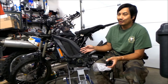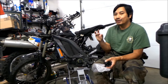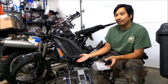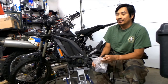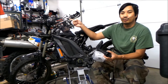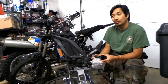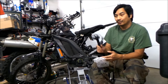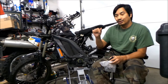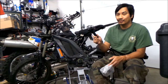I changed it with a brand new throttle box and it's felt a lot better than the one I replaced — those throttle boxes wear out after a while with all that dirt getting up in there and gunking it up. With this new one, there's less chance of that happening because all the mechanical parts are on the handlebar. You could still probably get a stuck throttle if you don't have handguards and drop the bike, but there's a lot less to go wrong — no cable stretching, no cable adjustment needed.